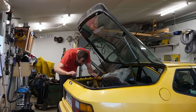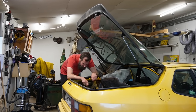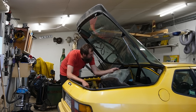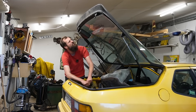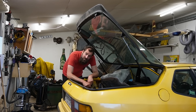I also noticed a couple of rubber grommets that are missing that I think, together with the seal right here, is the cause of the exhaust smell. So I'm going to put some rubber bungs in them and hopefully I've got a couple of problems sorted. I also need to wire up the rear wiper because it is cut at the moment — I will also do that. But this will be all for this video. Thanks for watching and see you in the next one.